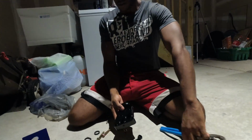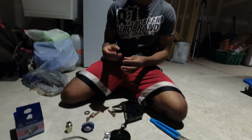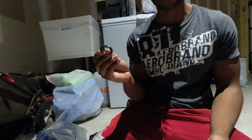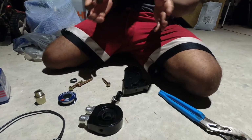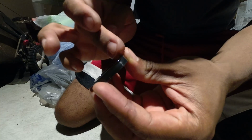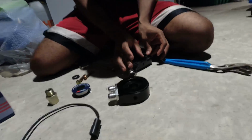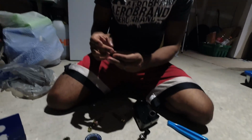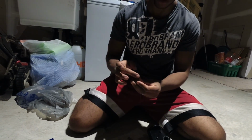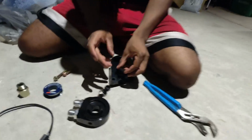Now, let's go ahead and get our gaskets in. As Moody said, you don't want to put dry rubber on dry metal. That's never going to make a good seal. So, take some of your old oil, just a little dab, and just run it along the seal. What you want to do is run it along the seal that goes into the oil filter housing. Okay, that's one. That's the large one. Here is the small one. You don't need much, just a smidge.